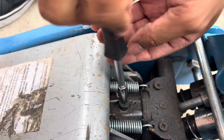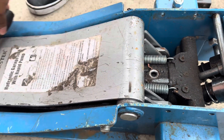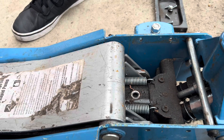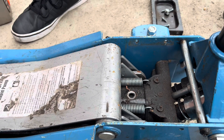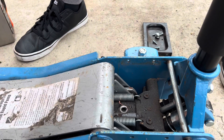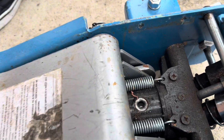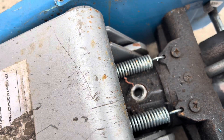You should clean this up before you open it, to be honest — you don't want dust going inside. There we go, now we can top this up with fluid. The plan is: you're going to release the valve but not engage it. What I mean is, don't turn the bar — keep it flat, not in the lift position. Then pump it first to see if there's any fluid coming out.